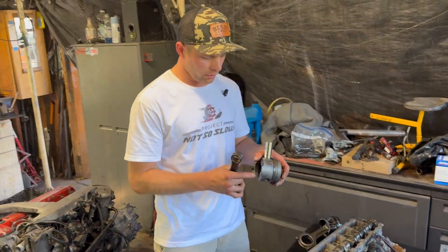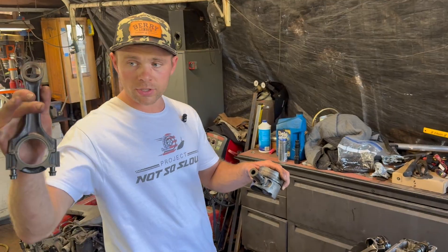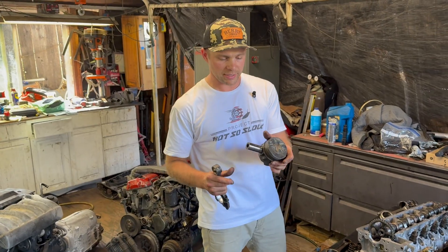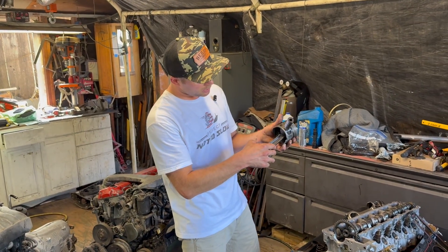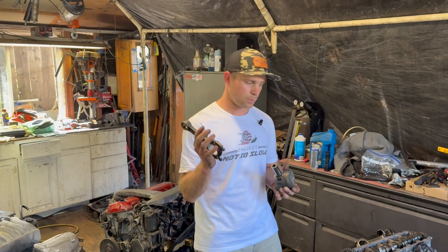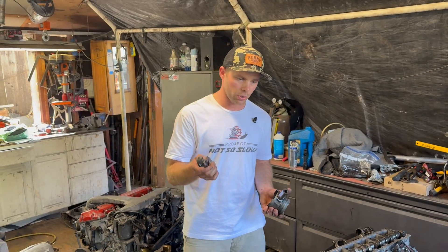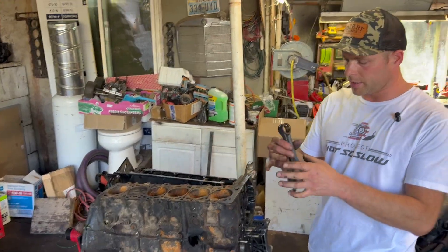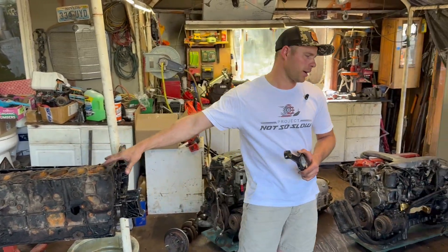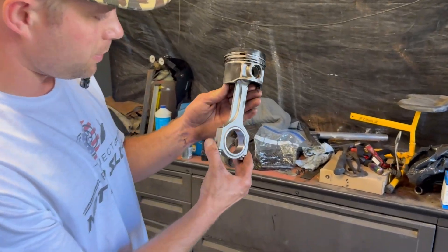Something worth mentioning from F-Tune videos: the turbo 606 rod fits a turbo 603 piston perfectly and is actually a great upgrade if you want to put a bit more than 400 horsepower through your 603. It also fits a 602 and a 601. Because of the slits in the block, the turbo 606 rods will probably outlive the 603 block due to the lubricating passages.